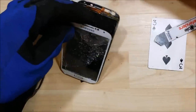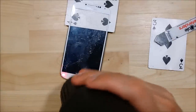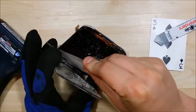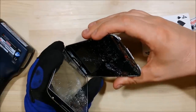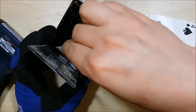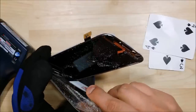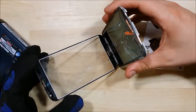I'm going to heat up the bottom portion again to let that glue separate from the glass and make it a little bit easier. I put the playing card in at the top to make sure the adhesive didn't stick back down. I'll try the playing card first — I would suggest not using a metal opening tool, but to be honest, they're a little tricky sometimes and that's usually the easiest way to get that cable to come off the glass. I'm going to have to use the metal opening tool — just stick it in there and gently pry it away from the glass. It's some pretty sticky rubberized 3M double-sided tape — this is what they actually glue displays on with. There we go, went ahead and removed it.